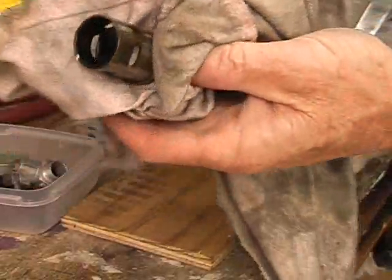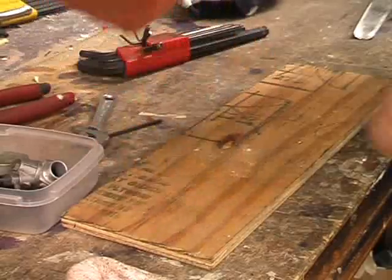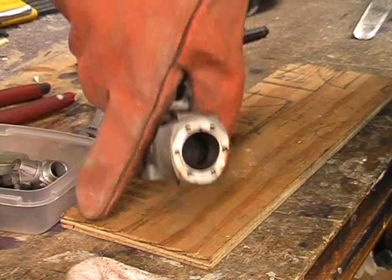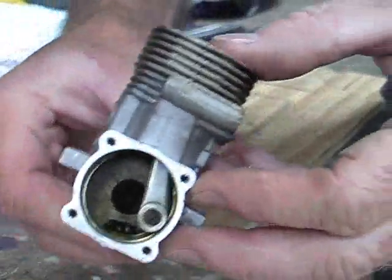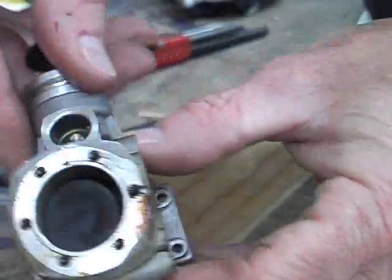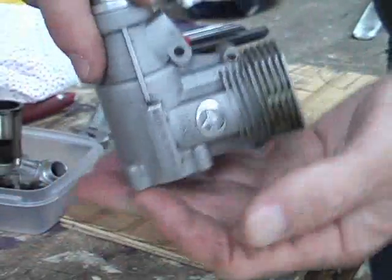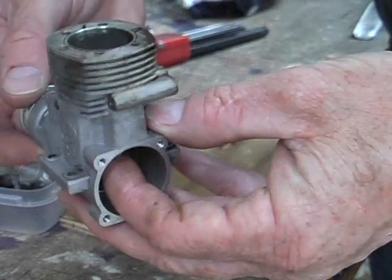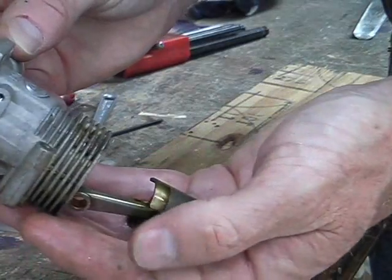There it is. Now you can look down and see there's a big gap between the piston and the casting — that makes it easy for us to get the piston out. To do that we have to take the conrod off the crank pin. Put the engine to top dead center, hold it with the backplate area down, give it a little shake, and just hook your finger in there — it'll pop off and the piston will be free to come out of the motor.